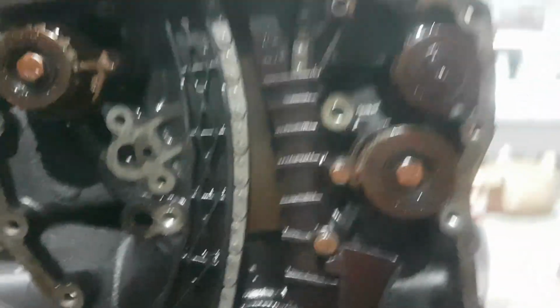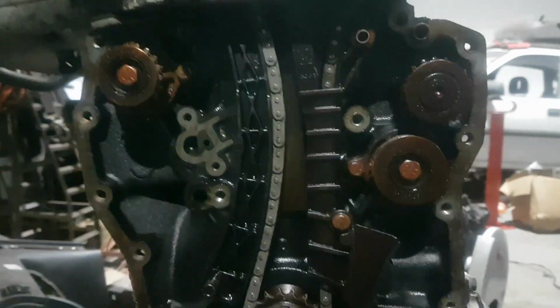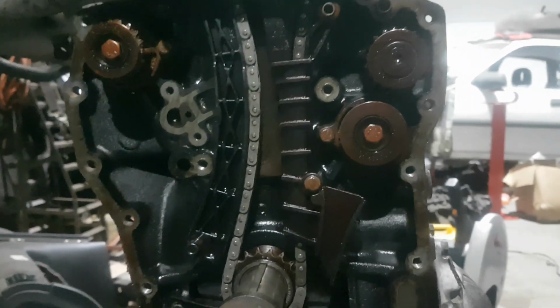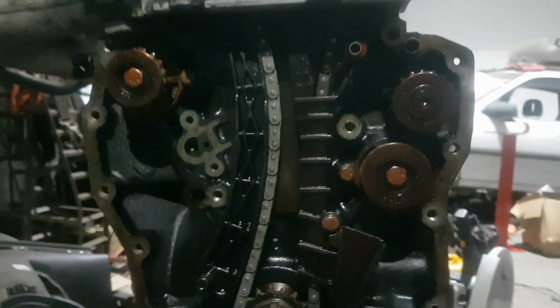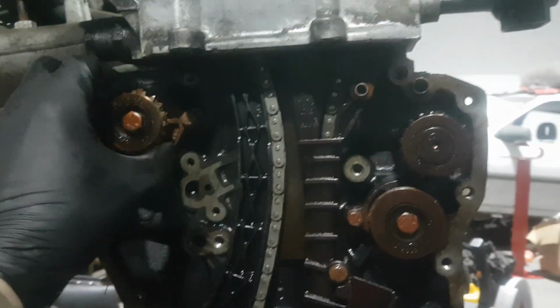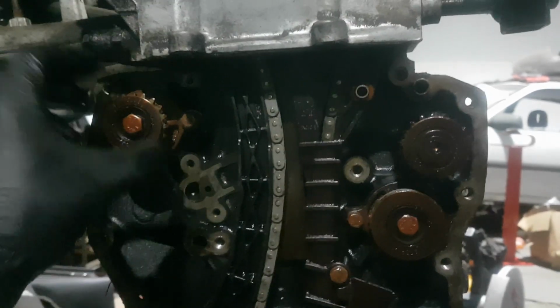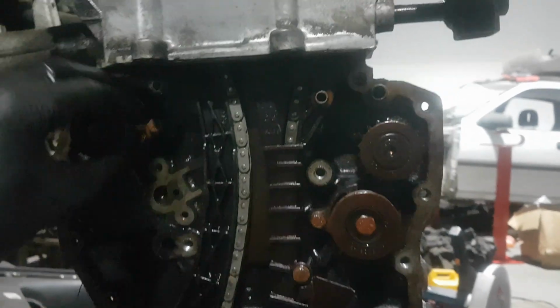To make life easier for yourself, me personally, try and find out as much information on your engine and roughly what year it is. The reason is because Saab made two different size balance shafts, early and late. I can't remember now, I think one or two millimetres difference in diameter between early and late. But Nick Chisholm will tell you more about that.